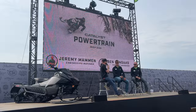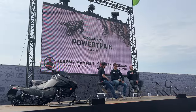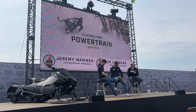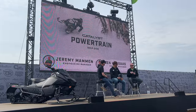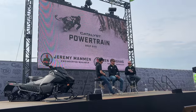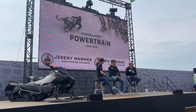That probably contributes to the reliability Arctic Cat is known for. When we launched the Catalyst last year, we launched it with the CTech 2 600 — not just the old ordinary 600 slapped into the chassis. Some significant changes were made. First and foremost was the crankshaft. We went with a bigger, stronger crankshaft common to our 800cc engine. It has a larger pin diameter — we went from a 27mm crankshaft pin to a 30mm crankshaft pin — which gives us more durability.